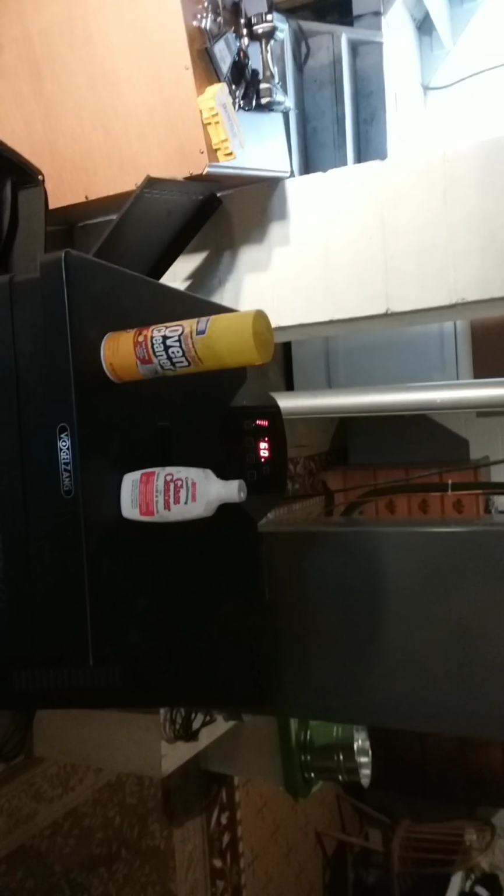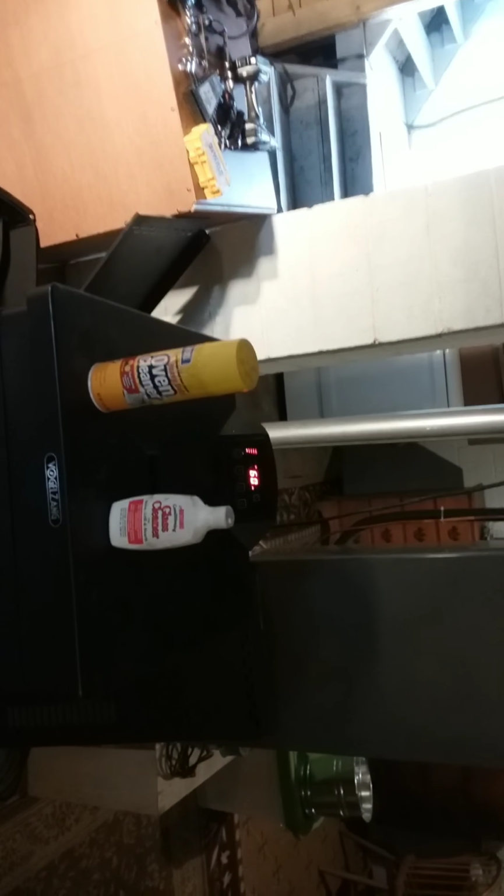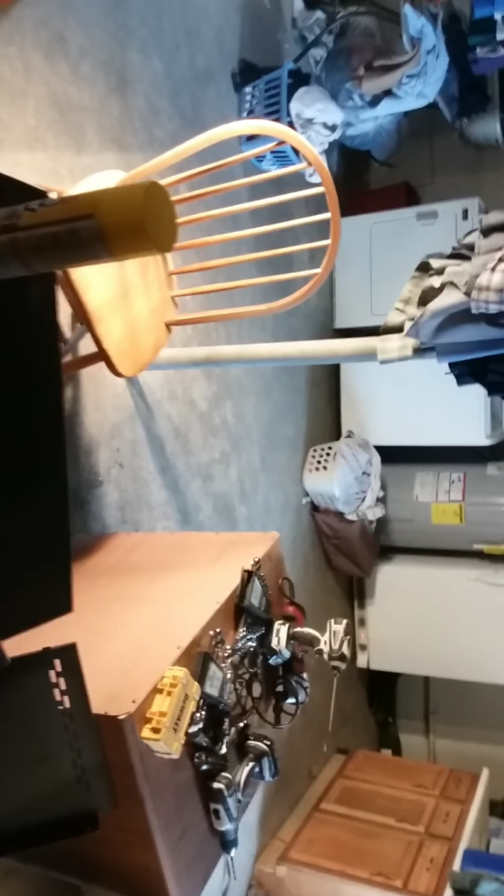Anyway, that's how you fix the E2 problem on the Vogelzang. And not only that, it fixed the E4. E4, I believe, is just another cleaning, airflow error, but check me on that. And you have to adjust your airflow accordingly back here. See that? That goes directly underneath the pot and allows your airflow to come in. If you have that too high, you're going to get ash. If you have it too low, you're going to get a low, cold flame, which will muck up the pot.